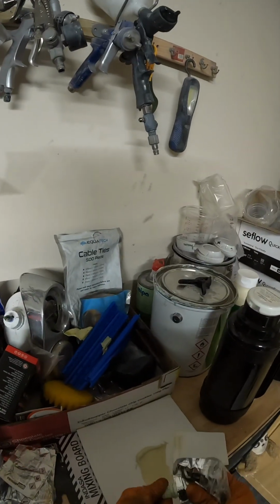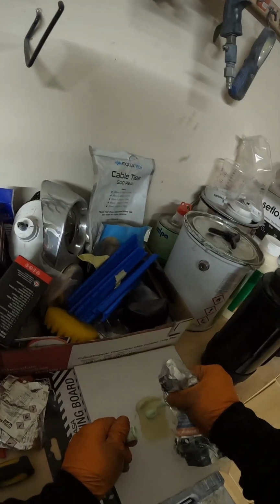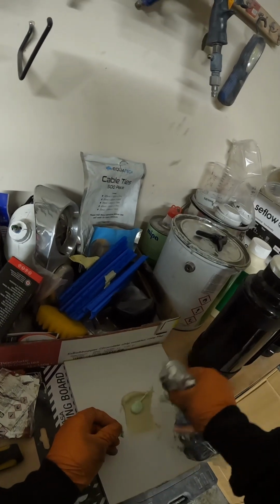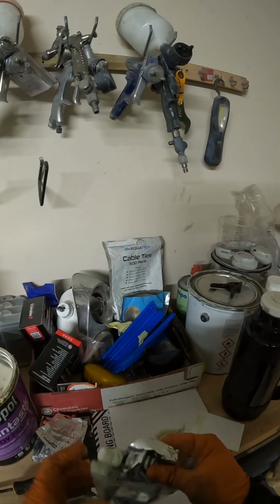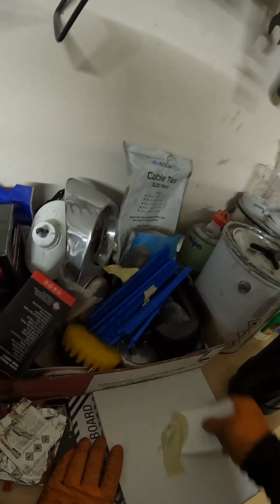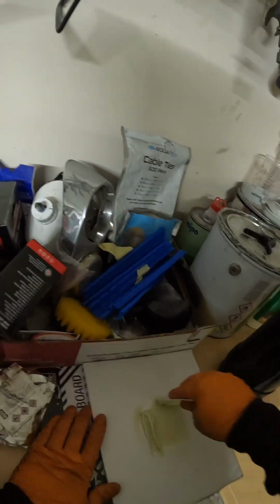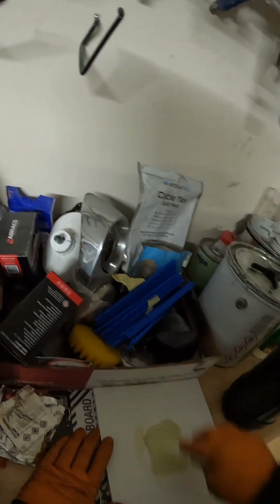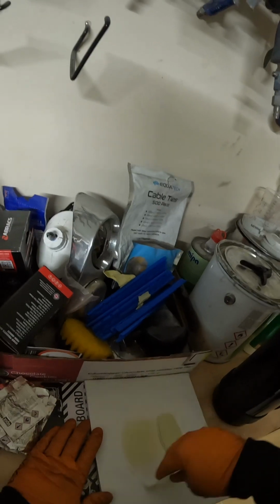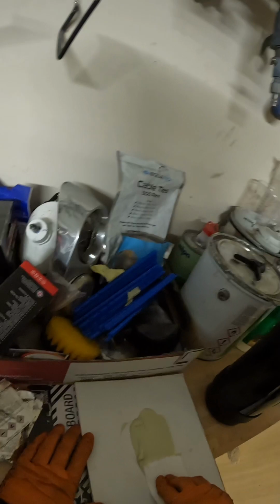And that's it. Little tips and tricks like this will save you absolute bags of time when it comes to doing these repairs. As you can see, this is probably not quite 50-50, but it's just enough so that the Dolphin Glaze gives us a little bit of smoothness. So I'm just going to mix those together first before we put any hardener in. Fantastic itself is quite a smooth filler anyway, but you can sometimes find it a little bit draggy and pinholey, so putting that Dolphin in just stops any of that.